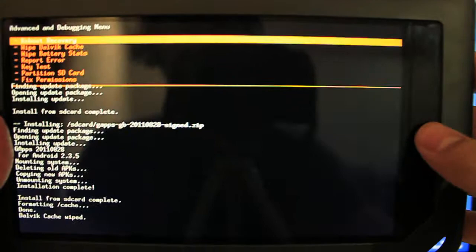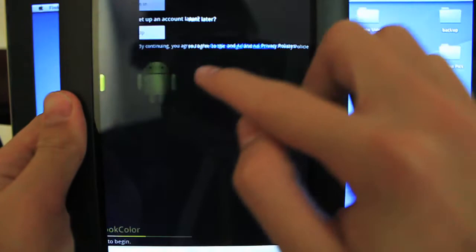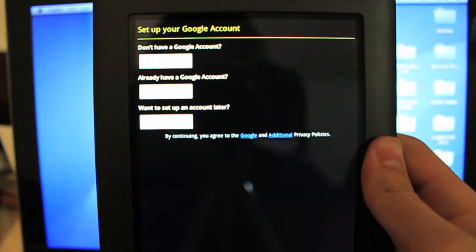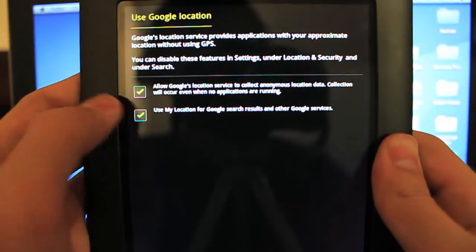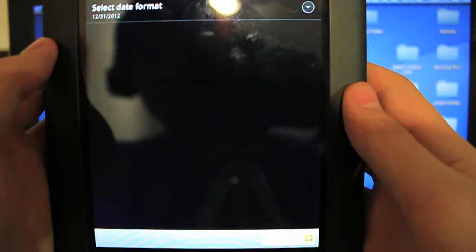On the back of the device, remove the bootable SD card from the slot. Once that's removed, click Reboot on the Nook Color button. Now that the CWM recovery SD card is gone, it'll boot right up into CyanogenMod. You should see a 'Welcome to the Nook Color' screen — just follow the on-screen instructions to set up CM7. This has been iTouchStuff — that's with a zero. Hope you liked this video; check out my channel, please subscribe, and I'll see you in the next video!